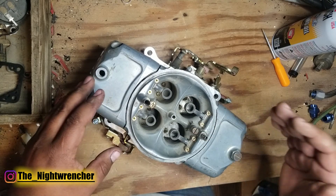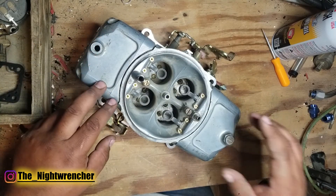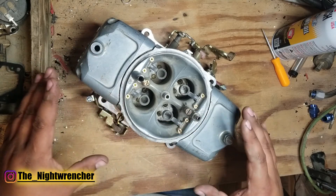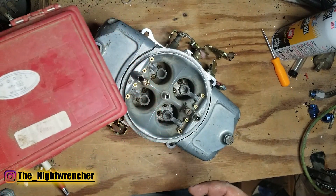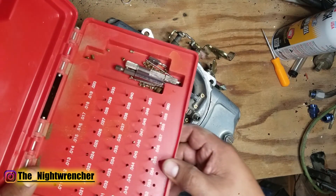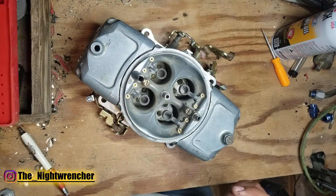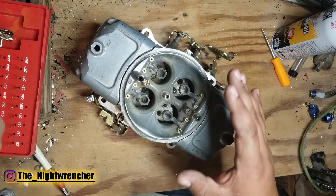In order to figure out where you want to be, you've got to figure out where you're at first. So what we're actually going to do right now is take off the fuel bowls, take the metering blocks off, take measurements off of the orifices in the metering blocks, and make notes of what jets and what power valves we're going to be using. To accomplish this, we're going to be using something I seem to use very often on my channel, and that is a pin gauge set. It essentially has a bunch of metered rods that are pre-calibrated to specific orifices. From there I can take my metering block and measure each orifice one by one, and then I'm going to be writing it all down on a piece of paper.